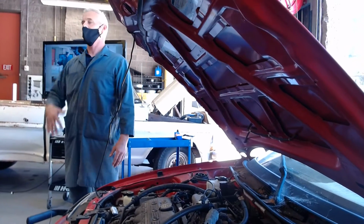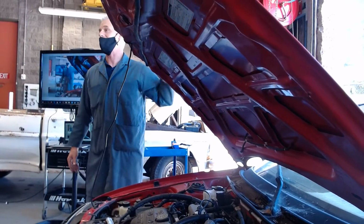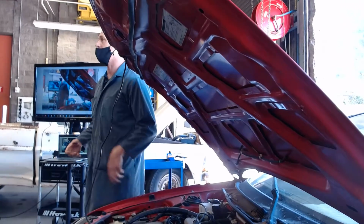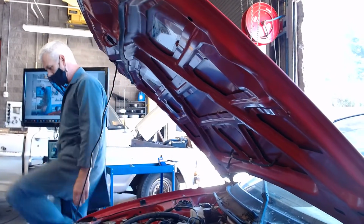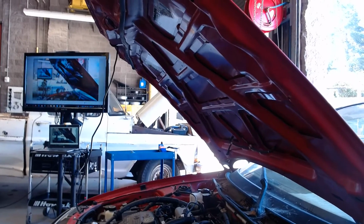The Platte River overflowed, and it had water to the headrest. Silt from the Platte River, mud, went on the timing gear. When they tried to start it, the belt rode up on the mud and slipped timing, and the car wouldn't start. So when we got it, we took the timing belt off, cleaned it, lined it back up, and started.